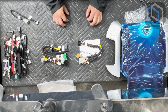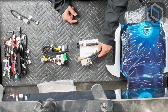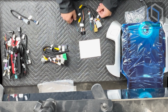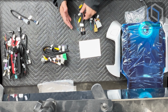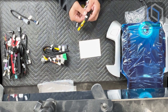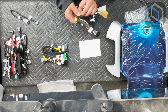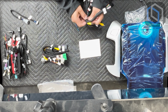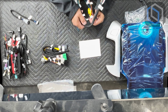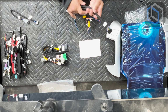So in addition to that one bag with the Chime and the CAN box, if you have the IO3 audio system in the vehicle, this is going to be the accessories for that. Now, IO3 basically just means no steering wheel controls, no Bose. And one thing to pay attention to is where the factory backup camera comes out of. Now, in these vehicles that don't have the factory steering wheel controls, no Bose, there is the main harness here. Let's go over that together.